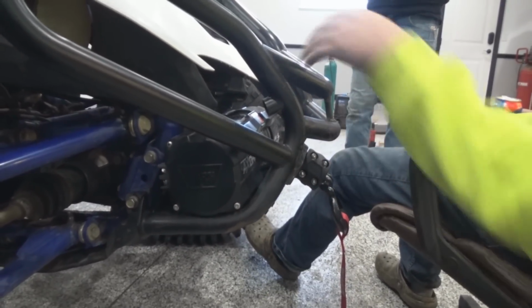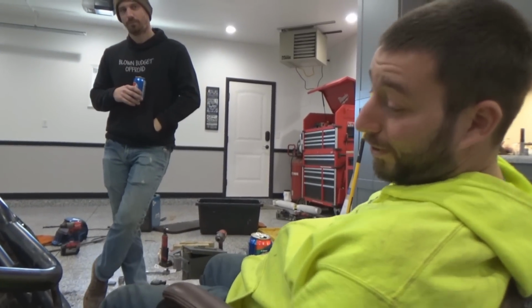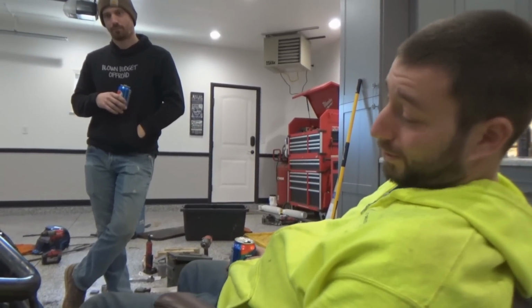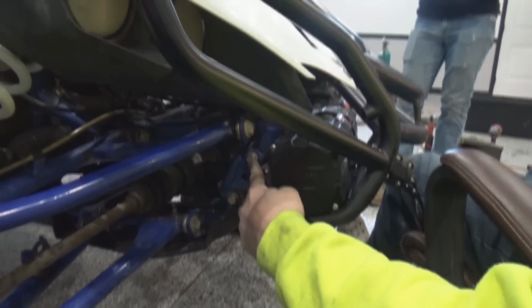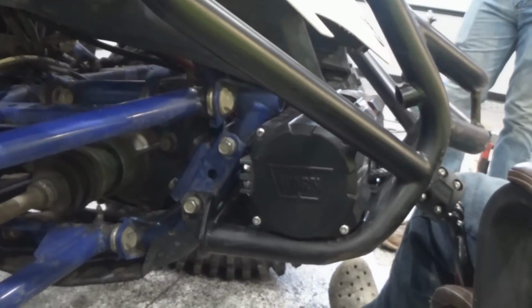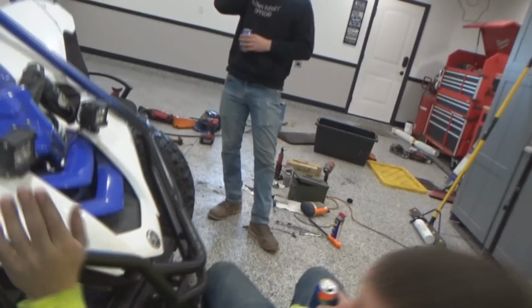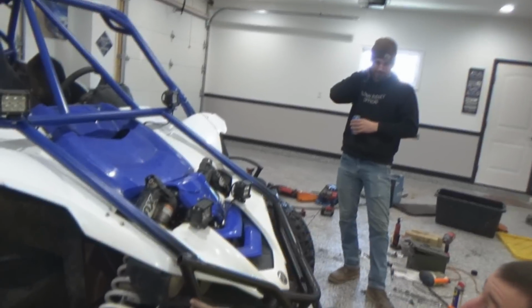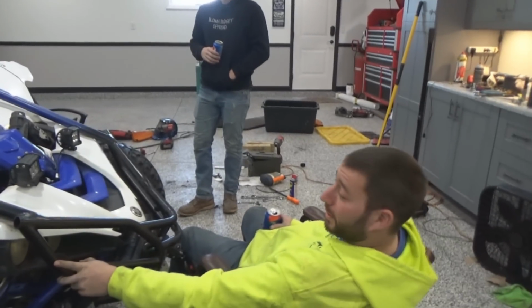But it didn't center the spool in the center of where the fairlead would go. So I had to drill some new holes on that too. And as you can tell, it bolts here, and it used to bolt here with that magical bar that's non-existent. Yeah, the one that the Sawzall deleted. So to make a new point, we just busted out my grinder, and it made 2 more new points to keep this thing where it needs to be.